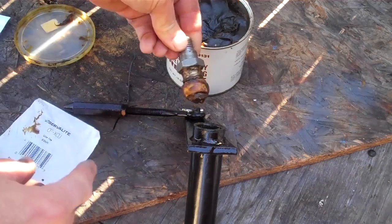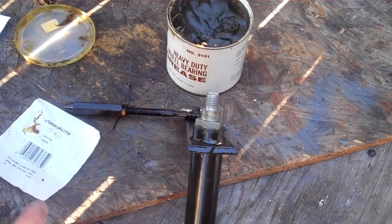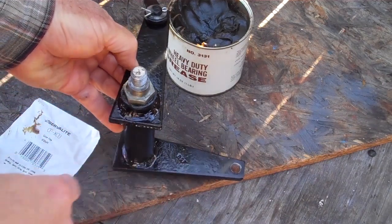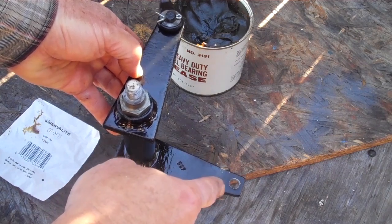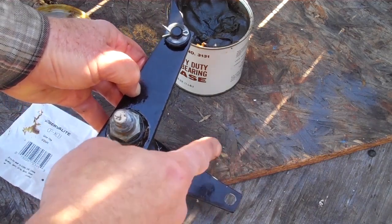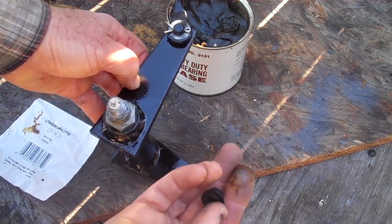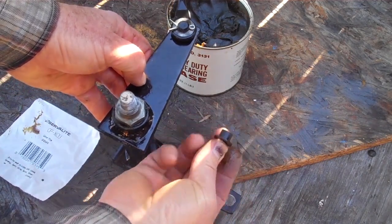Put a little grease on that — wheel bearing grease. I had to drill out the hole here on the equalizer bar a little bit. It was just a little bit tight when my friend fixed it, but it had been worn oblong and had worn a hole in the clutch pedal rod — the rod that goes from the clutch pedal to the equalizer bar. It was worn out and didn't have a bushing in there, so this bushing wouldn't fit once it was repaired.